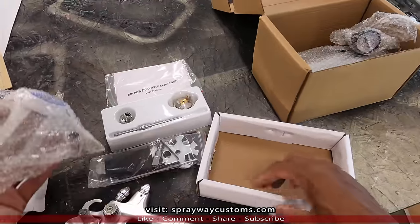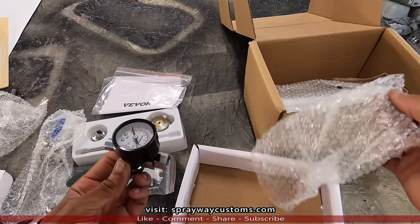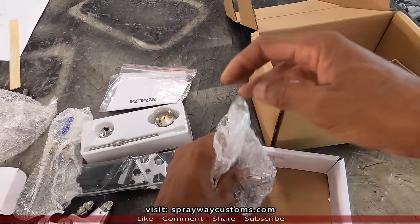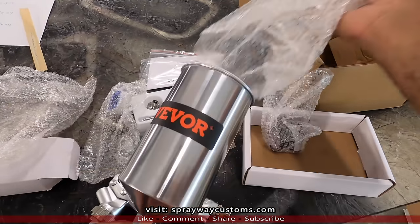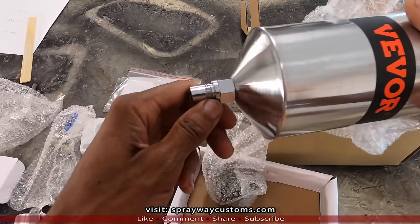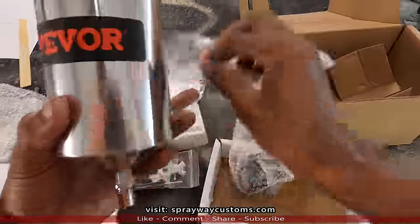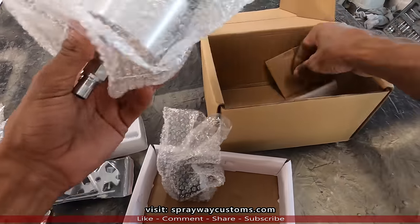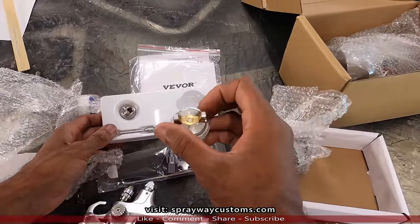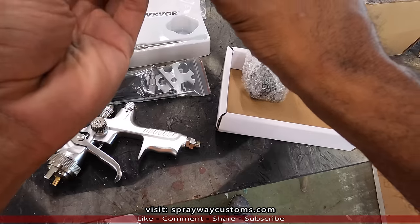It's Teflon tape and a fitting. It also comes with a regulator. I won't even use this regulator, I use my old one, so I'll keep it in the package. It'll be shipped out as well. And here's the cup. I might not use this cup because I think I got something that'll work on this one here, just so y'all have a fresh cup. I'm not sure, but I'll check and see. But this is it, y'all. 1.7 tip. It's somewhat too big for base coat, but it'll work. It'd be good for primer, but I'm gonna use it for base and clear.